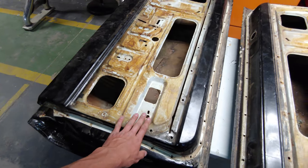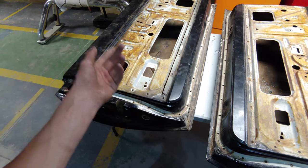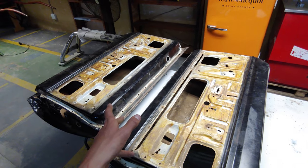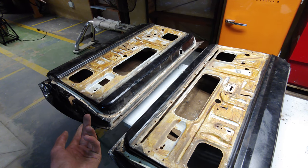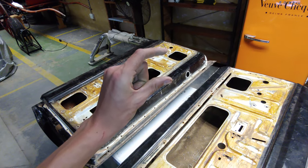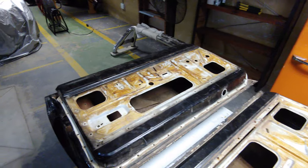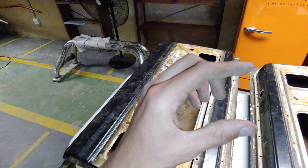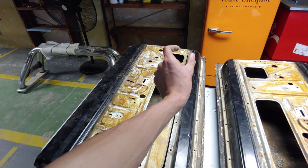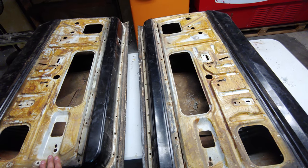The reason for that is back then they didn't spray the insides of the door or galvanize it or have proper seals, so water that got in rotted it out. Here in Southern Africa, back when these cars were made there was barely any tarmac — these cars were driven on gravel roads. A lot of dust and sand would make its way inside, and no joke, about five centimeters worth would accumulate. The dust generally clogs up the drain holes underneath the doors, and whenever the car got into rain, that dust and sand would act as a sponge, keeping moisture against the metal for long periods of time. That's why they rot out. But overall, the doors aren't in that bad a condition.